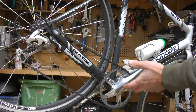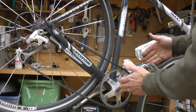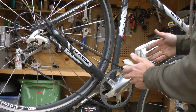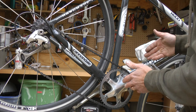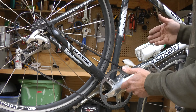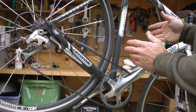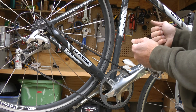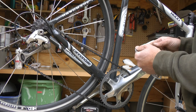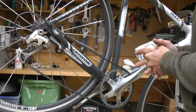I've been very surprised by my average times, which have dropped by a mile per hour since I got it — I really can't explain that. Yes, there was about a pound and a half less weight, but that doesn't seem to account for it. The difference in crank arm — this is a 170, the old one was a 175 — I honestly couldn't feel any difference, but since my seat was set at the same spot as before, maybe something with the effective seat height could explain the speed difference. It was a dramatic improvement in my average times. It's been a fantastic product, highly recommended.